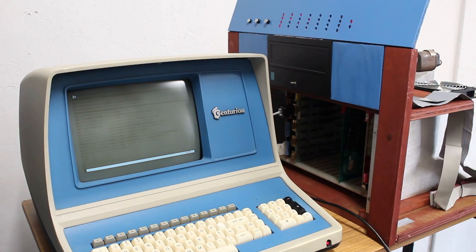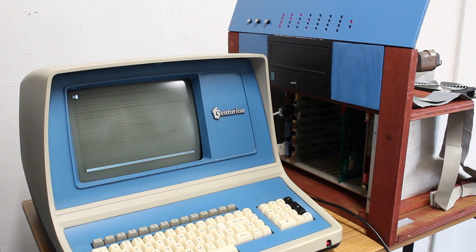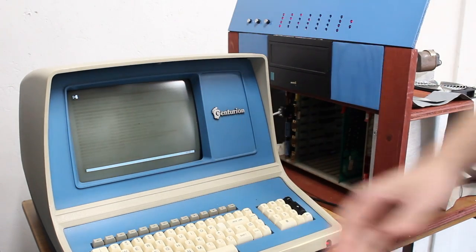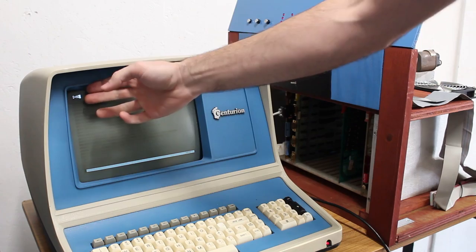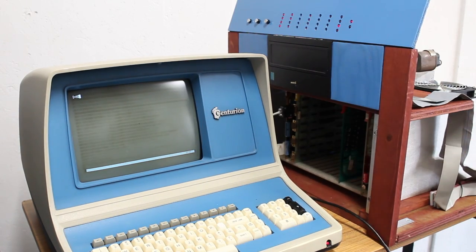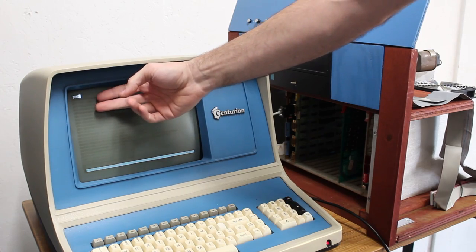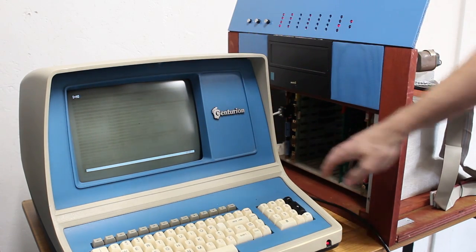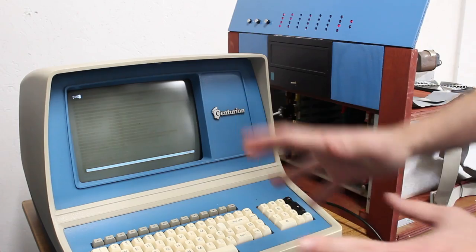Fortunately I have a spare bootstrap ROM from Ken Romaine. I popped it in — flip the power on — there we go: 'D='. We got a 'D=' prompt. It's not all fun and games just yet, because typing 'H0' to boot from a disk just causes it to freeze and lock up completely. But I think it's time to plug the diag card in, run a few tests to make sure things are copacetic, and then try to get the floppy and the FFC card in and get it booting something.